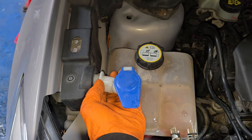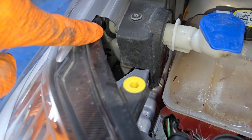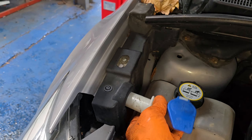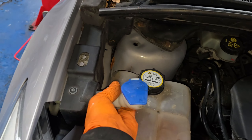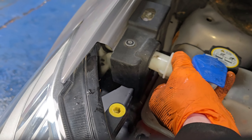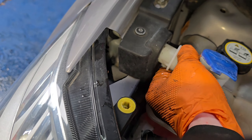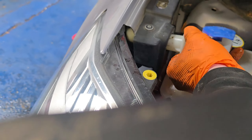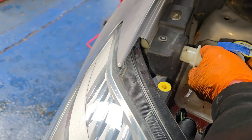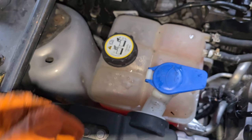The first thing you're gonna do when going down to the washer bottle is remove this pipe — it goes into a little rubber on the side here. There is a clip on it. You can just wiggle it out; just make sure you're going back into the hole when refitting it. Push on that clip while you're pulling and it'll pop out, which will give you access and let the bottle fall down later. It just pushes back in until the clip goes on.